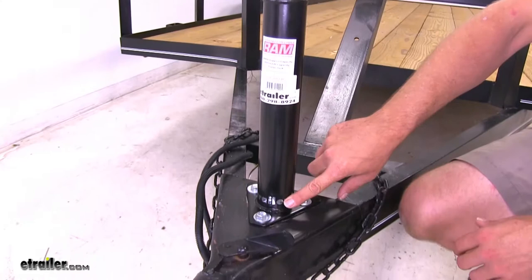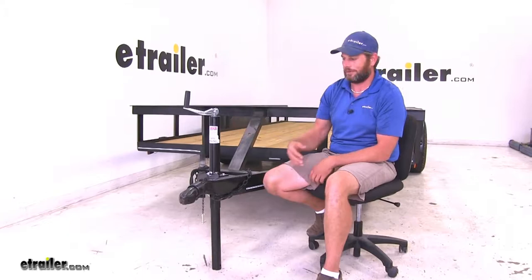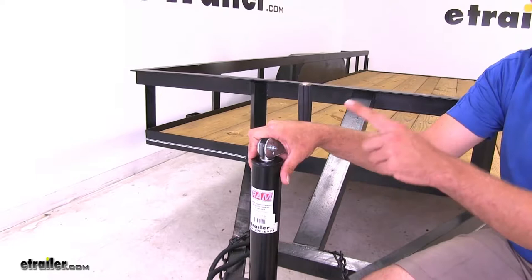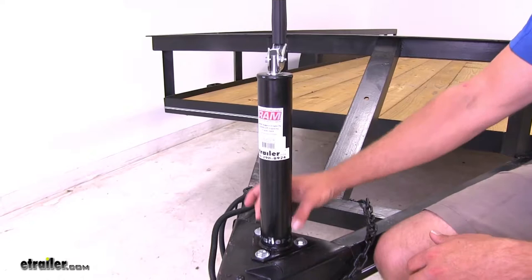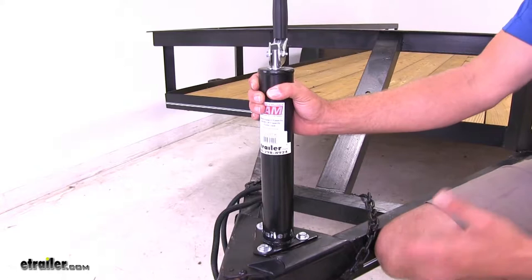They build it simply and easily — rather than gears, it uses a nice long Acme screw and a nut, so there are very few moving parts that can get damaged. This system offers really easy, smooth operation since we're not trying to mesh two gears together, so you won't get that grinding feel that some jacks have. Because of the simple design, all of the parts are located inside the tube of the jack, making it really resistant to weather and very hard to damage.